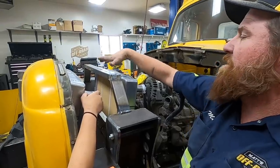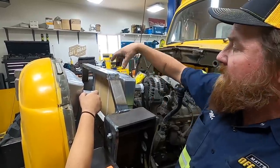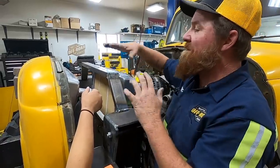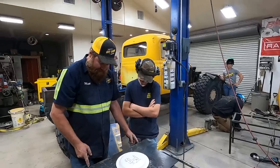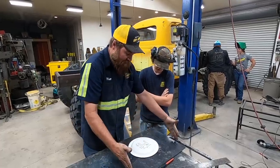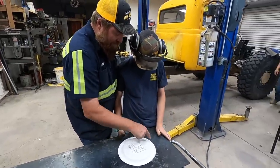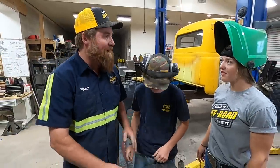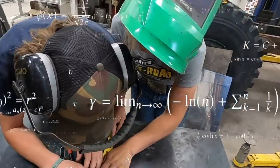We've got to get the top core support for these radiators. I'm going to have a piece that bolts to this — there's going to be a rubber pad with a pin in it like we did on the bottom. It will locate them side to side and hold them in place. If the radiators need to come out, just undo these bolts. I'm going to make it out of one medium-sized plate. It's 18 inches long, that's your first mark, and 13 and three quarters is your second mark. Copy that — everything inside is three inches, three inches, four and three quarter, three.